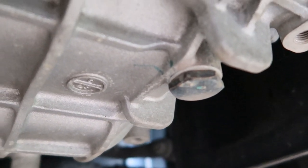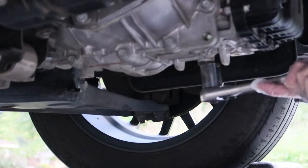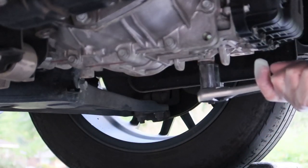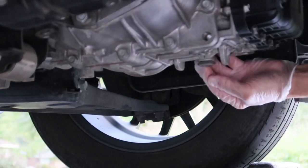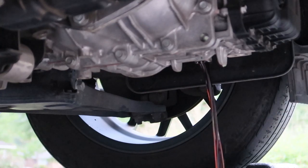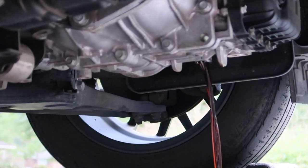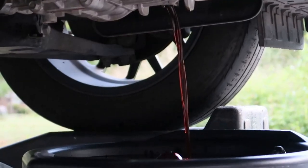We're going to get ready to open this up and get our drain pan in position. Make sure your drain pan is completely empty — that is the only way we're going to be able to tell exactly how much transmission fluid to put back in once we're ready to refill. Once you get it broken loose, slide it off and it'll flow quite quickly. You can see the transmission fluid looks pretty decent. Kia recommends you change this fluid at 60,000 miles; if you want to be more careful you could change it at 50,000. We're going to let this completely drain into the pan so we can account for all the fluid we're going to need to replace.